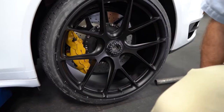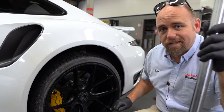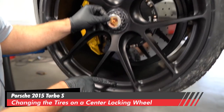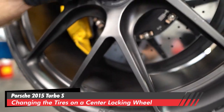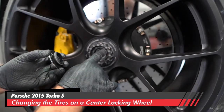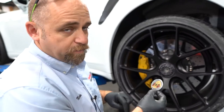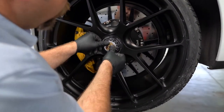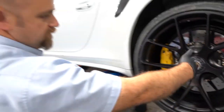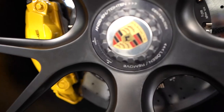Now we're ready to put the Porsche caps back on, armor-all the tires, and it's done. Porsche crests always get pointed toward the valve stem, except for center locks — kind of a bummer. This standoff piece has to go into that divot, and it all depends on where the final torque ends up is where this crest is going to point. The crest has to point right here — that's the only way we can flush that. The crest is not pointed to the valve stem, but that's alright because it's got a center lock. That's it for these wheels and tires. Thanks for watching.